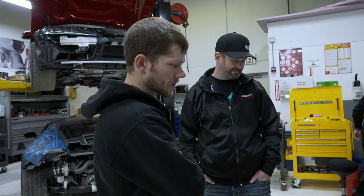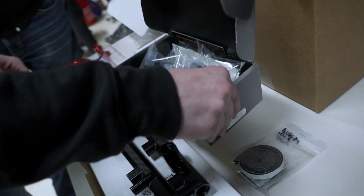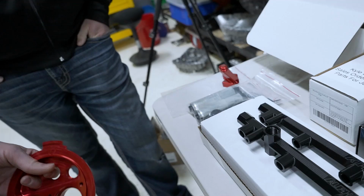Yep. And then this is our fuel system. You got the alpha rails. Lots of extra goodies. Injectors here. What size injectors are they running? They should be 1100s. 1050s. 1050s? Okay. And yes, we got the pumps. Cool. Pumps. Dual brushless pumps. Yeah, dual brushless pumps. The same thing as our GTR system. We just changed the other hard components and make it fit here.